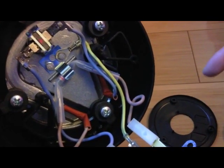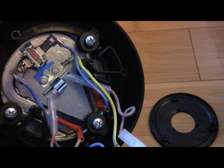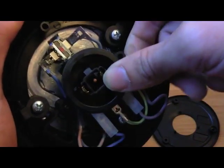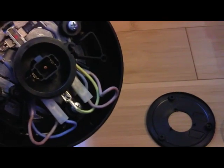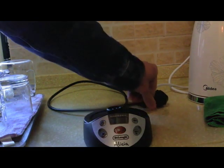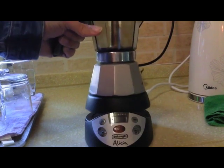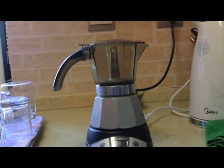Since you use it like any other water heater, it's best to unplug it after you're done making coffee. It's no less safe than the unit with the electronic control unit working. With this simple design, you have fewer components that could go wrong, and you have a working coffee machine again. I'll plug in this unit without the control electronics and brew a pot of mocha. Just put the pot on the base and it should start automatically. There's no indication since there are no electronics and no LED behind the panel — you just have to wait for the coffee to brew and finish.